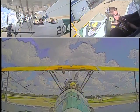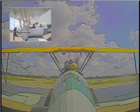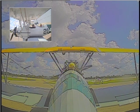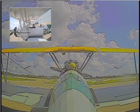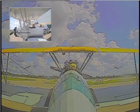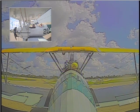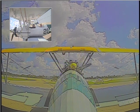The nice thing, I rolled this thing out this morning at 11, so I'm looking at my oil temperature. It's already close to where it needs to be anyways. So, all right. Make sure this thing runs for it. There we go. And we have oil pressure. Bottom right, the short little needle. That's the first thing we always look at when she starts, because if we don't have oil pressure, it'd be good to shut it down and investigate as to why.